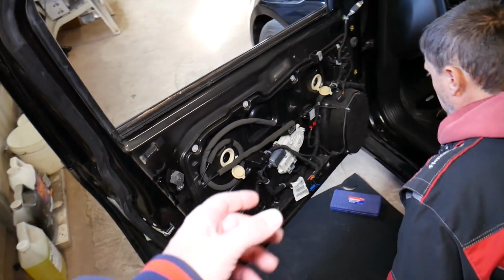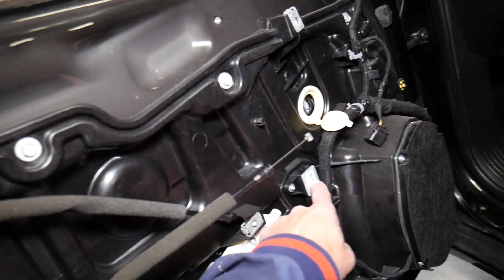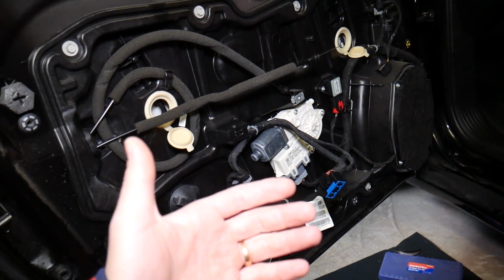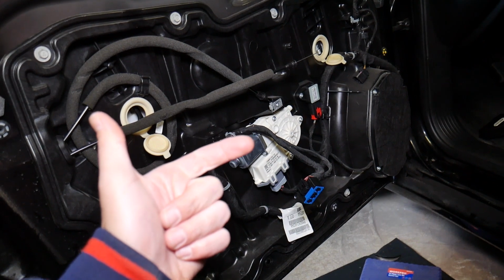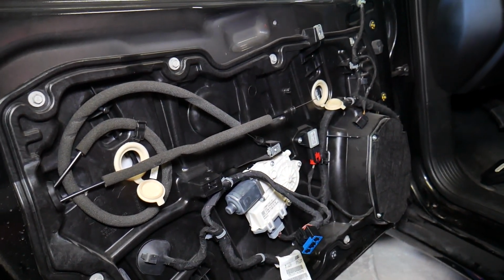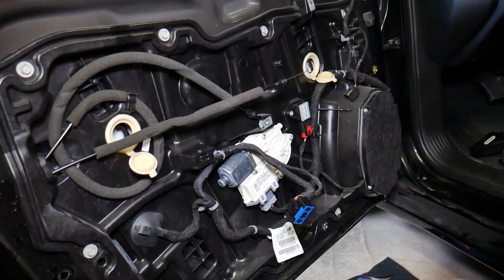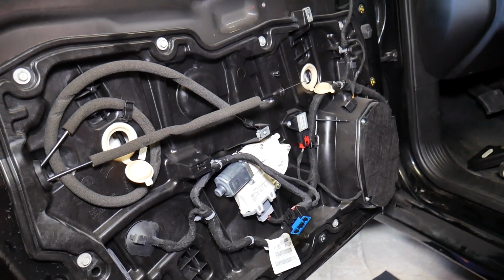So next, we're next to the side airbag sensor, that red thing right here, guys. This is your side crash impact sensor. So go ahead and disconnect the car battery at least for 1 hour, guys, before the repair. That way you will minimize the chance for something terrible to happen. Airbags can kill you, can kill your passengers, guys. Super dangerous thing. So always disconnect the car battery at least 1 hour before the repair. If you're not qualified and certified to work on those things, don't, guys, because it could be deadly. And consider this an entertaining video, not a how-to video.